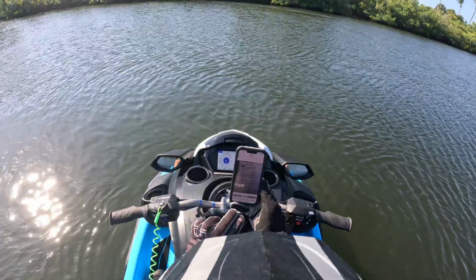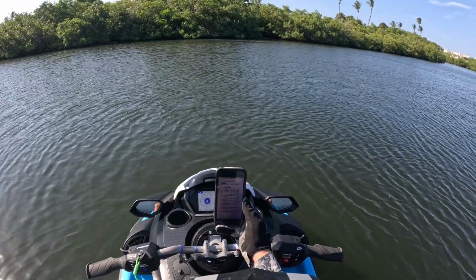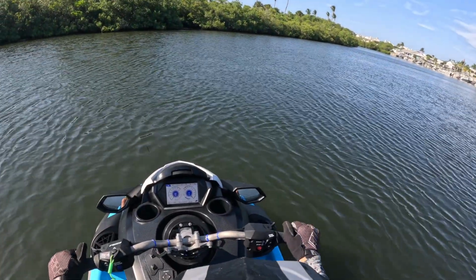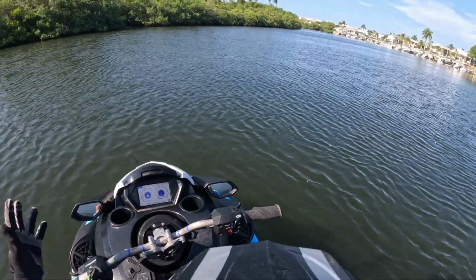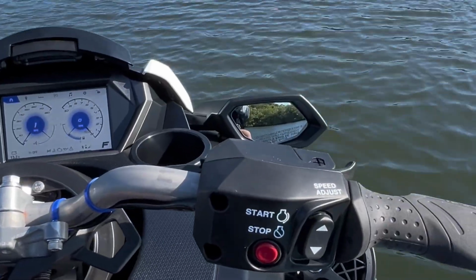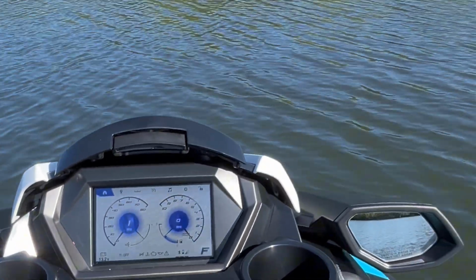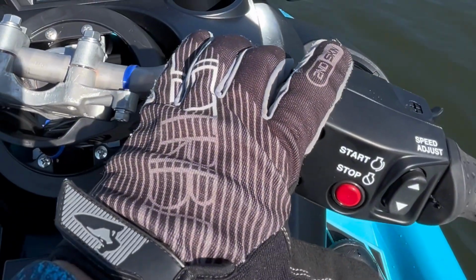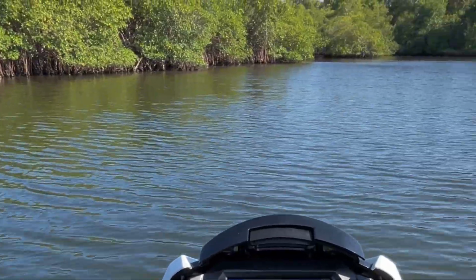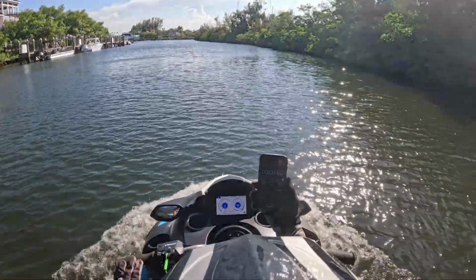You can see I have this part of the manual here on my phone. And so for the next 90 minutes, we're gonna operate below 5,000 RPM. So in a couple minutes, after we cool down a little bit, I'll fire her back up, and we'll do 90 minutes under 5,000 RPM. Here we go, 90 minutes.